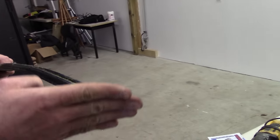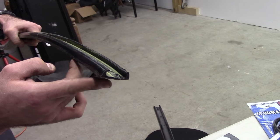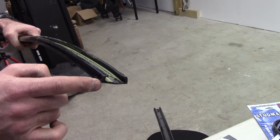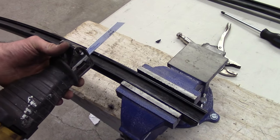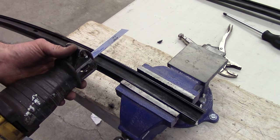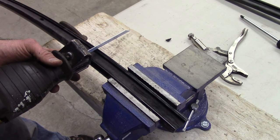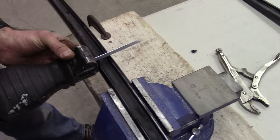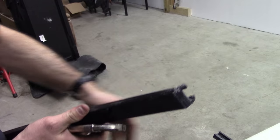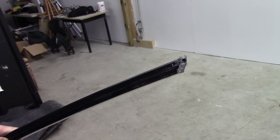If you look at the underside of the back end of the slide, you'll notice that it is tapered. The reason for that is when you're reversing, it allows the track to reverse over this seamlessly rather than getting caught on a sharp edge of the slide. So when we cut through this, we're going to cut about halfway through and then taper it towards the front. We'll cut our hash marks, go about halfway through the slide, then angle the blade of our reciprocating saw so that it tapers towards the front. You can see it's got a good taper — it's ready for reversing.